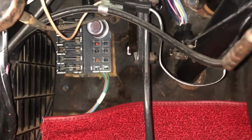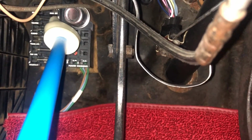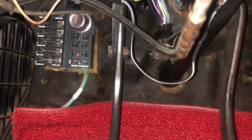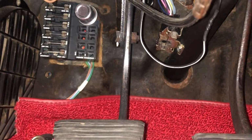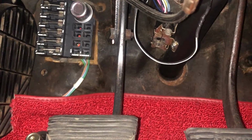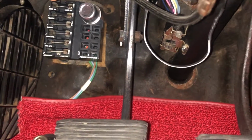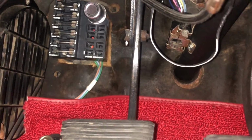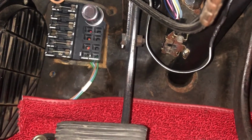Okay, here we pick up at the fuse block, and the one that kept burning out is this top 10 amp here. Some of the low-hanging fruit for trying to fix this is to take out the fuse, wipe it down with acetone, also see if the contacts are rusted or have some sort of condensation on them, dry that up, and then put it back in. Start the car and see if anything burns out again.